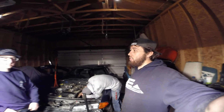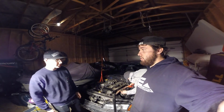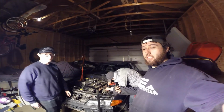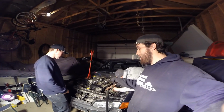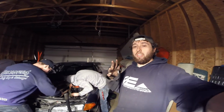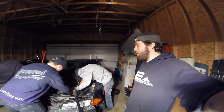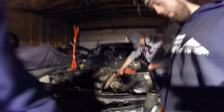I think I said this was a T3 in the last video, and his was a T2, possibly. But no, I was wrong. This is a T4. Yeah, it's a T4 and his was a T3. So it was too small and didn't work, but we figured out something. We didn't even film it. We just cut 2 gaskets in half to make a gasket together and used a little bit of gasket maker. And now we almost have the turbo in, if you can see that.